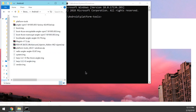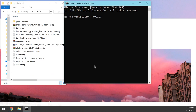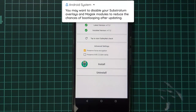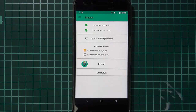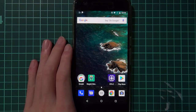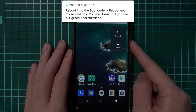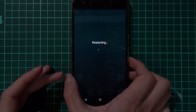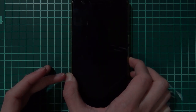We can now reboot our phone into the bootloader. This month's TWRP can safely decrypt the data partition, so you don't need to remove screen locks. If you have Substratum overlays, disable them before rebooting or updating. If you have Magisk modules that might interfere, go to the Modules tab and uncheck them. Then press and hold the power button, tap restart, and when the screen turns black, hold volume down to boot into the bootloader.